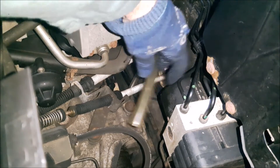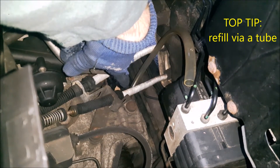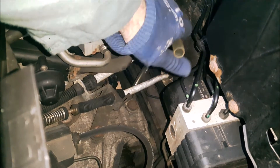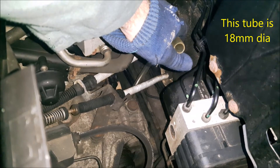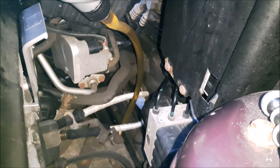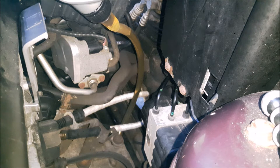On most cars I found the easiest way to refill the gearbox is to push a tube into the fill hole and then put the gearbox oil into the gearbox through the tube. The size of the fill plug is such that you can get a tube of up to about 22 millimeter diameter in there. I've got the bottle of gearbox fluid into the tube, which in turn is stuck through the refill hole, and I'm just very gently squeezing the fluid down the tube and into the box.